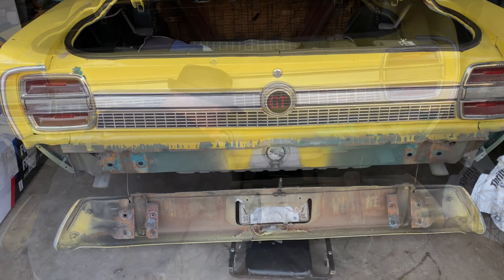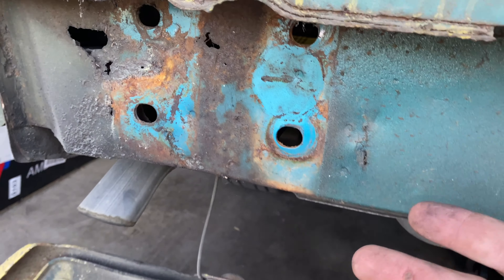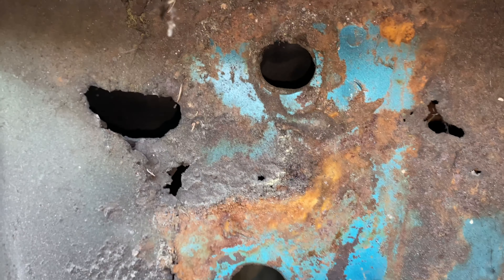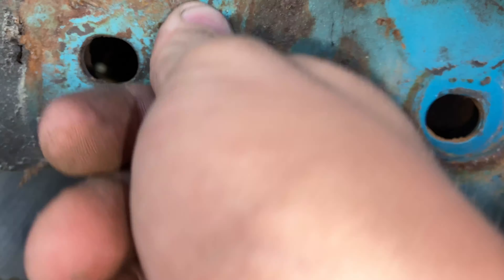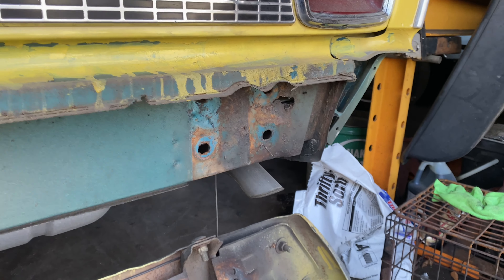It's self-explanatory — you obviously want to do the bottom bolts first, and then the top ones. That way the bumper doesn't fall on you. You may want some help with this. I'm doing this by myself, but if you have some help it would definitely be easier. Best thing to do is kind of take one bolt out, and then you can help support it while you take the other one out with one hand. The bumper's off.